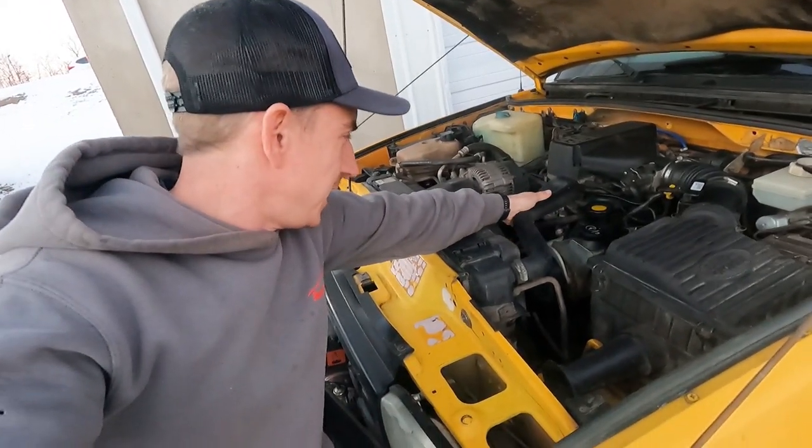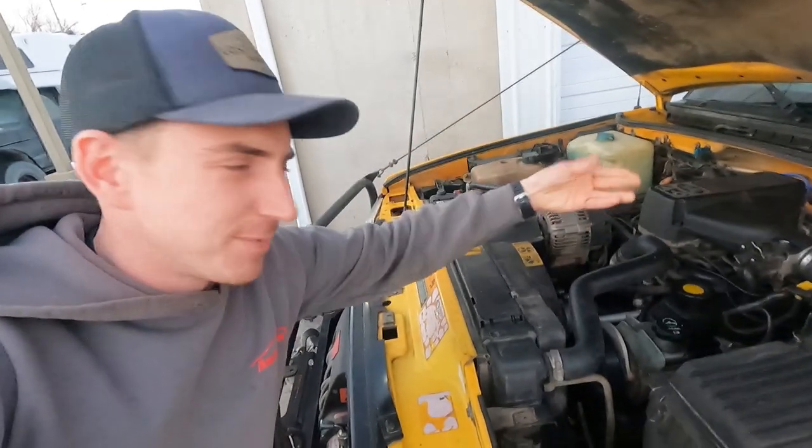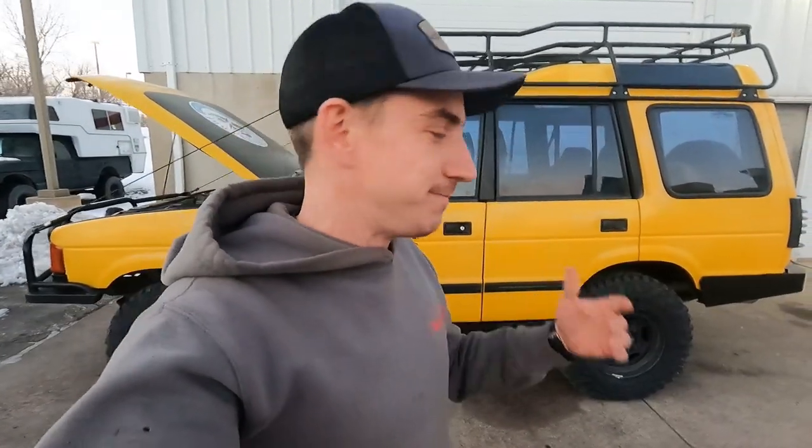You can't feel it through the camera, but we've got some slush in the old upper radiator hose. Shame on me for not checking whether the antifreeze had the correct mix. Being it's below zero right now — you can tell by my proper attire — it's like six below, cold enough to freeze it.